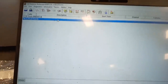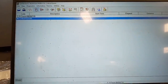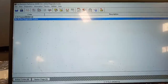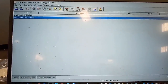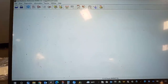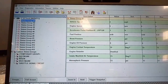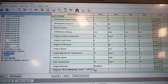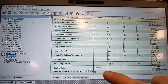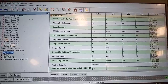Now we can actually fire up Old Smokey, and as you can see it is communicating. No faults logged, no events logged. So really all we have is the customer complaint, which was heavy white smoke and heavy fuel smell. I always like to make sure we have all our sensors reading correctly — if you have a boost pressure sensor, atmospheric pressure sensor, or a temp sensor that's not reading correctly, that can throw off your fuel ratios and fuel mapping for the ECM. So let's fire it up.